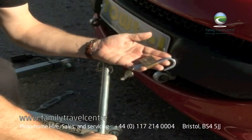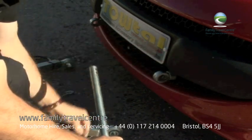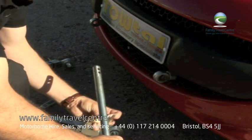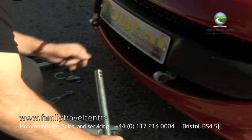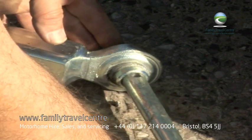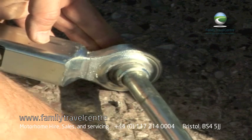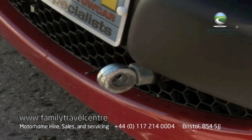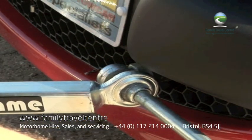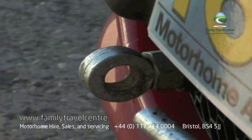We take out the padlock, the pin which locks, and the washer in that order, and we place those over where we're going to need them on the left pin. We then feed the pole just through the first of the rotating ball joints. We then lift the whole assembly and then feed the pole right the way through so that it just sits in the other eyelet.